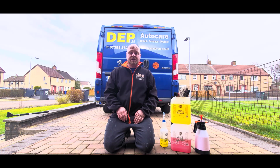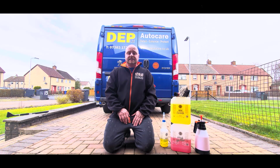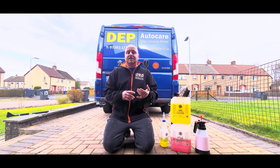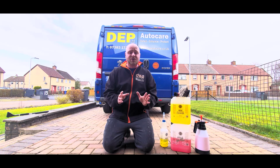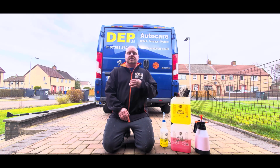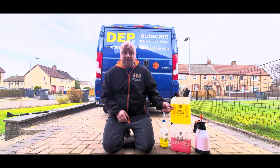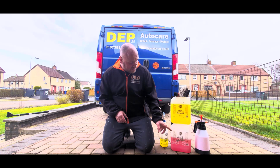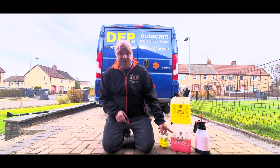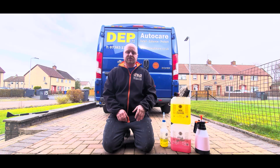Good morning, everyone. Sorry I've not been about for a wee while, but I've been really busy. Today we're going to have a wee tutorial on how to clean your wheel arches, whether it be metal, plastic, fabric, whatever. It's more or less always the same way that you do it. So today I'm going to be using Infinity Wax EPX and Infinity Wax Citrus Pre-Wash, both diluted to 5:1, just to make them that little bit extra stronger.